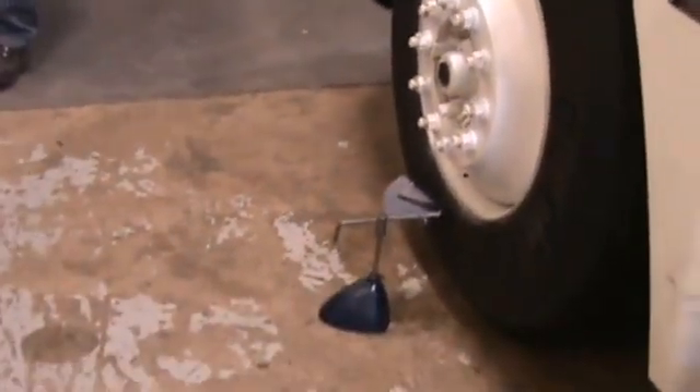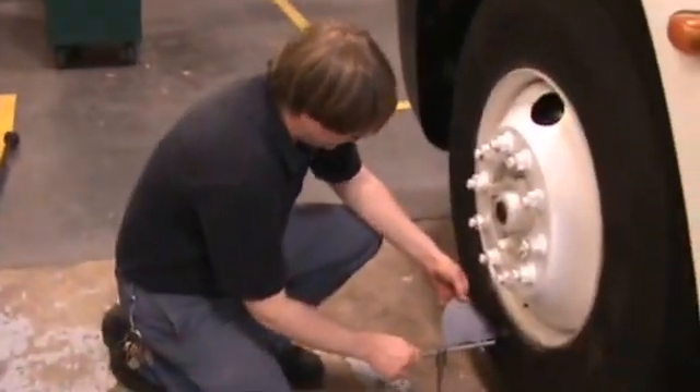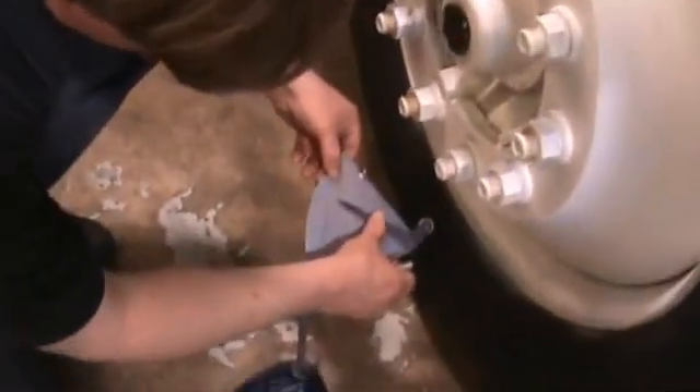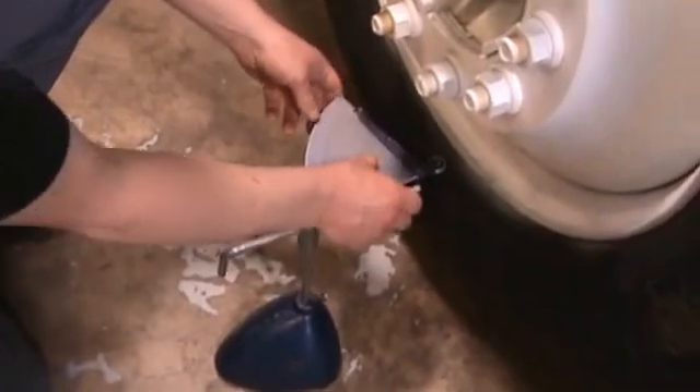For this tire, Pennsylvania regulations would allow a half inch of movement, which if you look at the gauge, that would be needle travel from this point to this point — considerably more travel. That is how you inspect kingpins as per the Pennsylvania regulations.